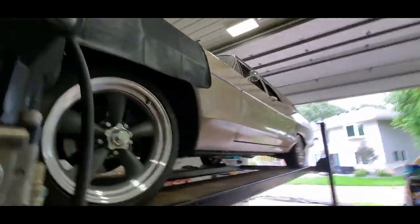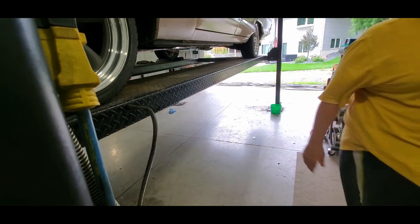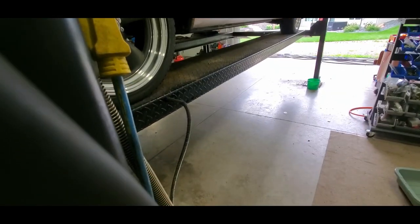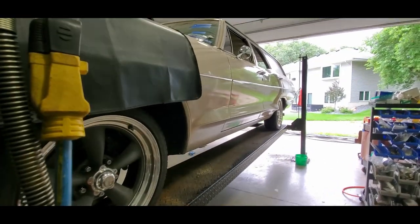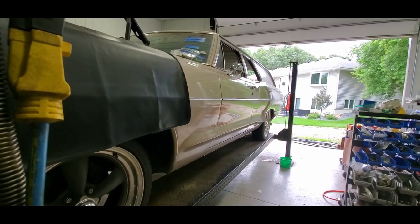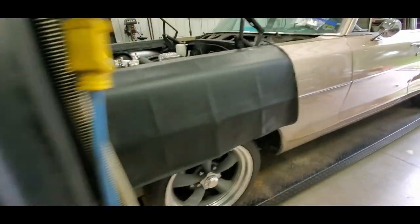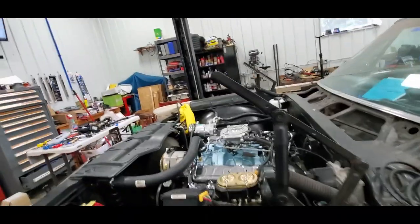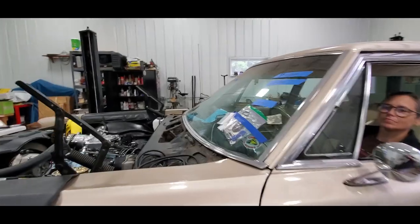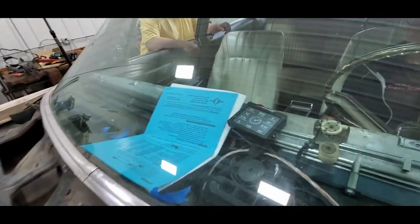Interesting. We were just putting air in the tires. IAC says it's zero. I can hear the IAC going. So I'm trying to run this and that, but I want to catch the sound of this because as soon as this is down, I'm going to put my finger over the IAC hole because the IAC says it's closed. What temperature are we at? That's where it was last time, right around 180. But watch this. Wow. This car is much taller suddenly. So that kit really does pick the car up.